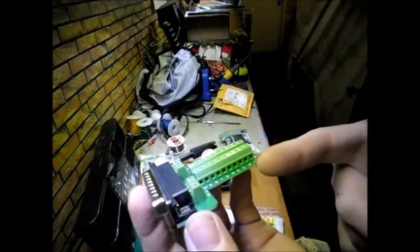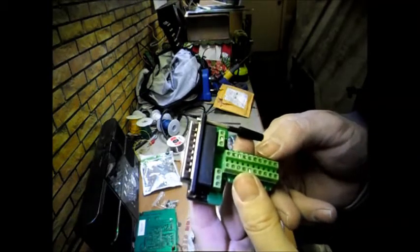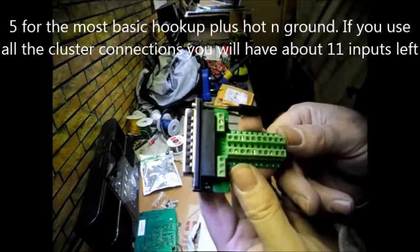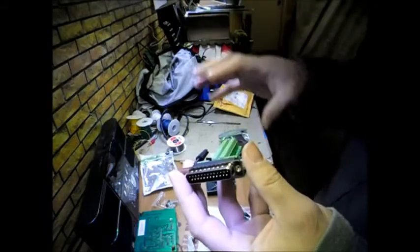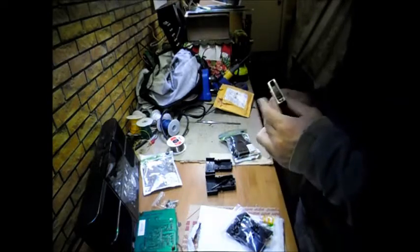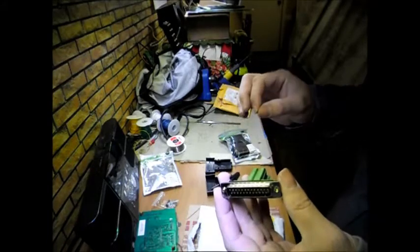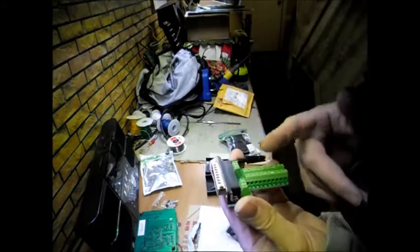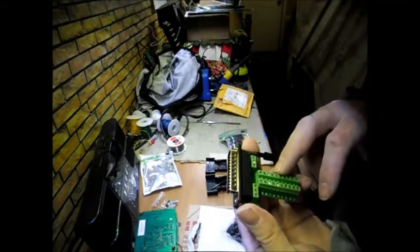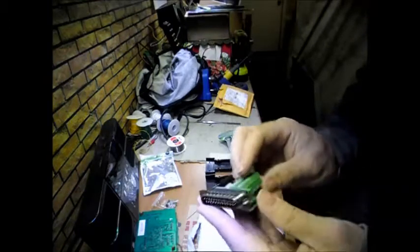Your pod buttons you can connect to this too, because you've got 25 of these - so five for your dash inputs and then you're going to have about 20 extra. Some people mold their pods to the dash, so you want to be able to connect it all at one connector. If you're using a pod with MP3 sounds you'll probably want to run that separate to another connector. I'm probably going to use one for my whole dash - 20 inputs for my pod connectors and the rest for the dash.